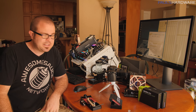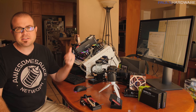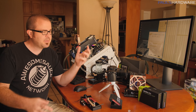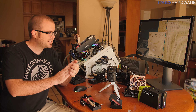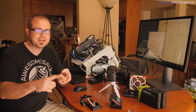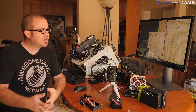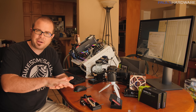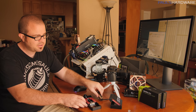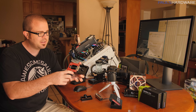What's up guys, welcome back to Paul's Hardware. Today's video is going to be my attempts to continue my overclocking experiments with the RTX 2080 Ti's in NVLink 2-Way, and I'm trying to upgrade this core system. If you watched the setup video, you might have noticed that I accidentally installed my 10-core 7900X instead of my 18-core 7980XE. I have swapped in the 7980XE, and I've got the Derbauer delidding tool for LGA 2066 CPUs right here.